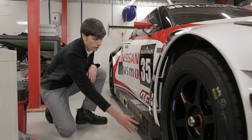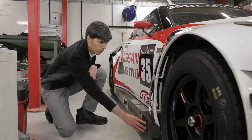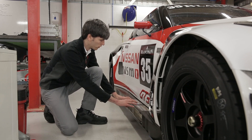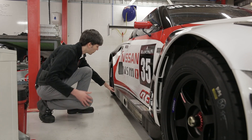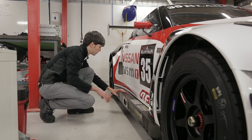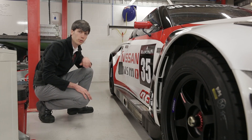The side skirts are also vented. The front vents help cool the catalytic converter, which is located just behind the front tire. There are also vents to help cool the exhaust. At the very back of the side skirt, vents allow airflow through the exhaust, help cool it, and then direct air back out through the side skirt.